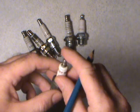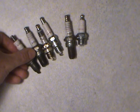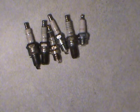Be careful when you're working around these things and make sure you keep it safe. Don't be working on engines while they're running — unless you've got lots of experience, you don't want to start losing fingers and possibly a hand. Any time you work on the electrical system in your car, disconnect the negative battery terminal and make sure it's not going to touch — that way there's no possibility the car can start on you. You might even have dual batteries in a pickup truck, so make sure you disconnect both of the negative terminals.